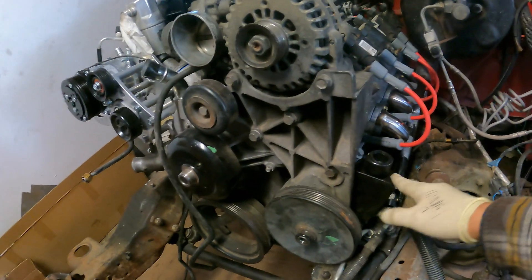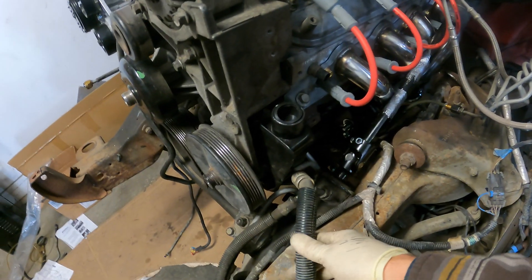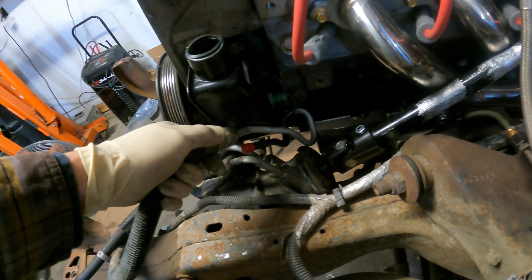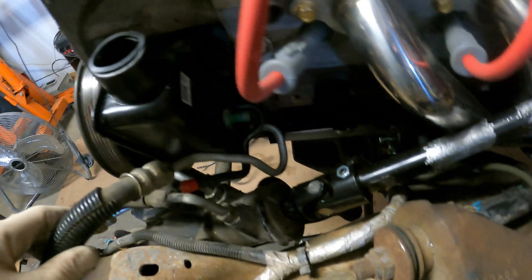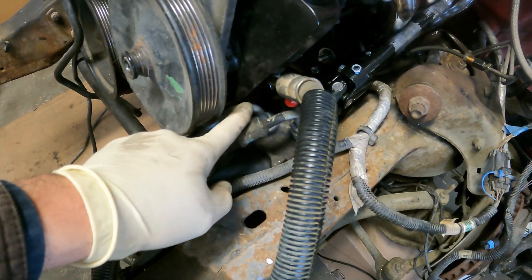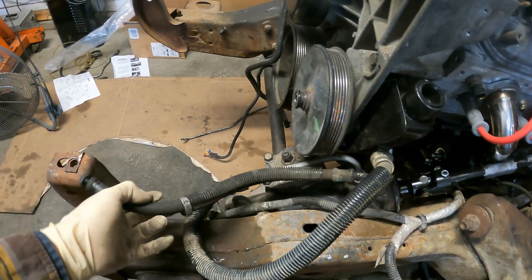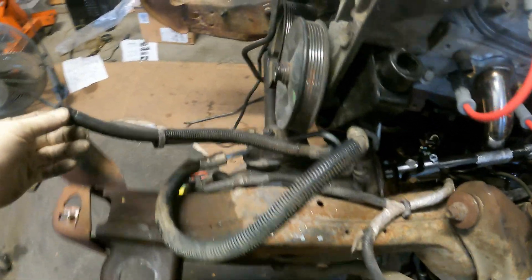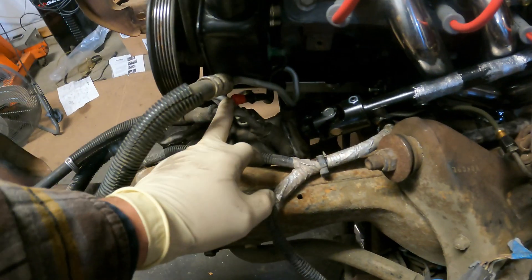I got this whole bracket on there with the alternator, power steering pump, and the pulley. It is a brand new power steering pump, and I was able to just use the Chevy pickup truck 1500 pressure line. Looks like we just barely have enough clearance — I did have to bend it back a little bit, but it comes up, loops around, and comes in right here, and it just barely misses the pulley. This truck actually came with a power steering cooler, which I'm going to want to run, so this line is going to come up, go to the cooler, and then from the cooler come back and go to the reservoir.